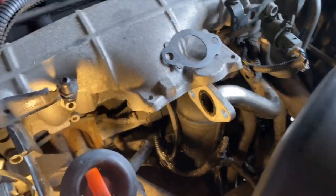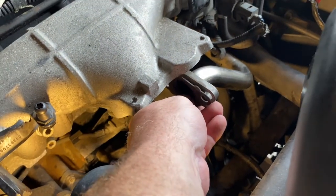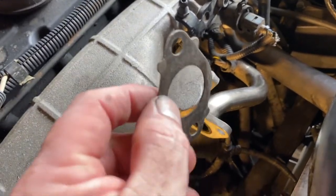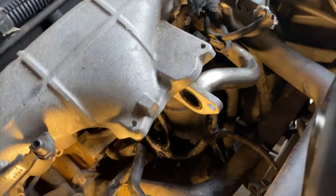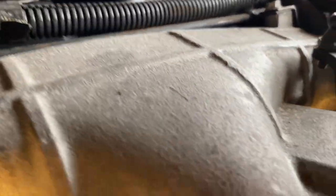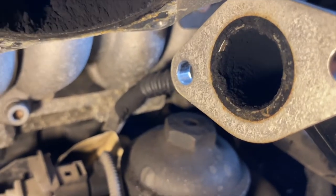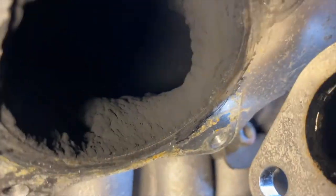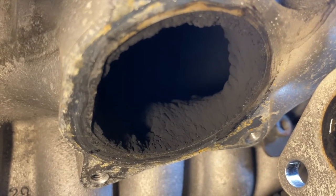Just a note — there is a gasket on the stainless pipe that comes from the exhaust that feeds the EGR. Mine is in very good condition — I've just cleaned it up with the green pad, same as the jointing surfaces. That pipe needs cleaning up, and the underside of the inlet manifold needs cleaning up as well.